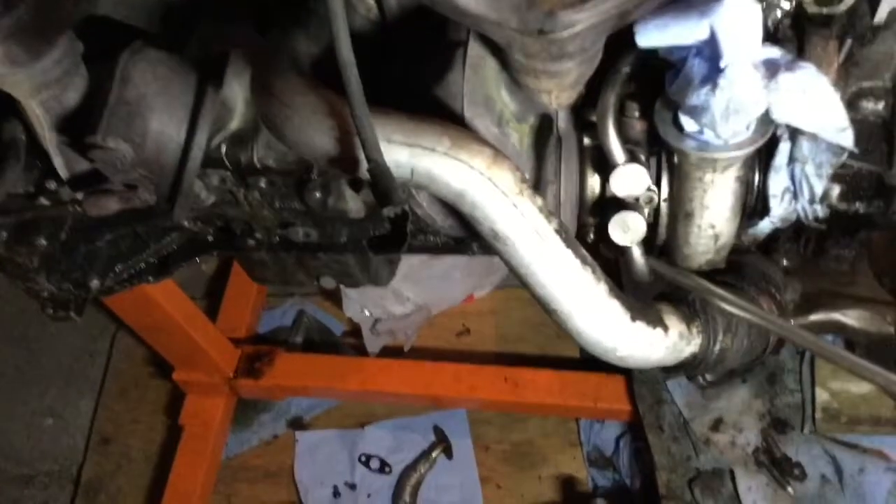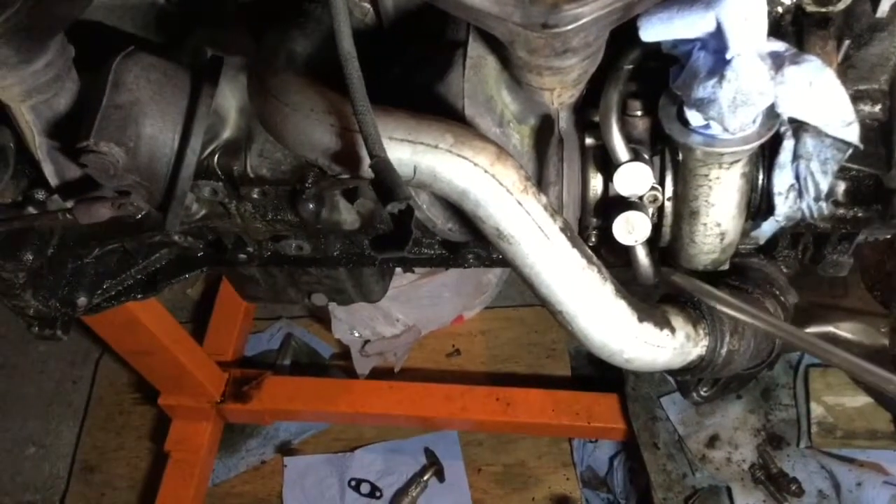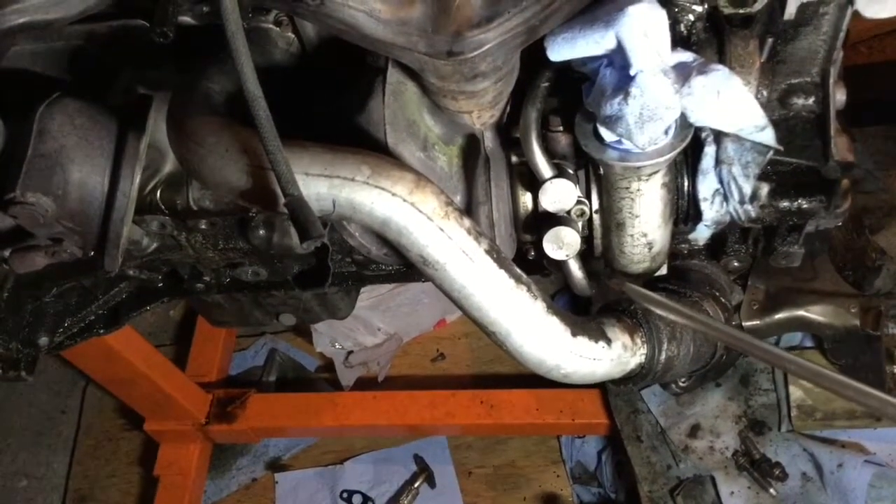It's hard to see, but same thing — just make sure it's all the way in. This one here is hard to reach with my tool. The bolt at the bottom on that return line for the front turbo is a bit hard to reach because of this pipe here — the steel pipe goes along and it's a bit in the way. So there's no need to try to force your way in and strip the head of the bolt.